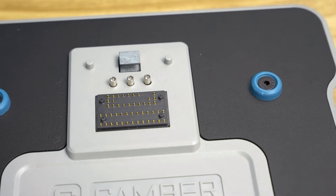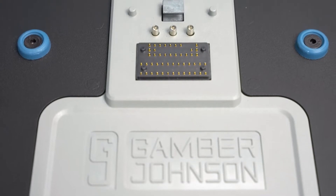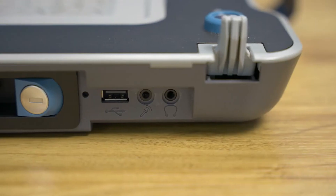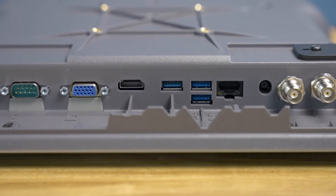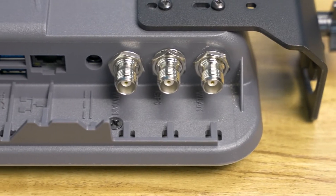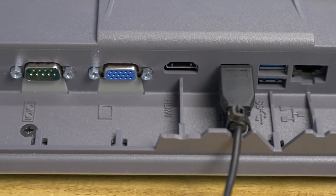The docking connector is located here. Be sure not to drag anything across the connector at any time, such as the laptop, clothing items, gloves, or bags. The dock features a full assortment of ports and RF connection to accommodate all peripherals needed for mobile workers to stay connected throughout their day. To keep your installation organized, install this docking station utilizing the integrated cable restraint and cable management system.